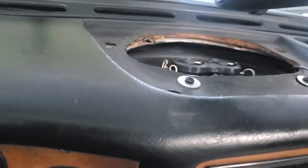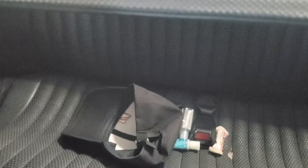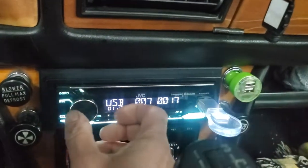This is just the speaker — it's a left and right channel. In the back, I actually have a powered subwoofer sitting behind the back seat where the soft top frame sits. That was about a hundred dollars and I didn't have to make any holes in the cubby holes. I'm an 80s guy and I like to listen to pop music, so there are songs with a bit of bass. This particular speaker can be configured as a subwoofer or a full-range speaker, so I have it as a speaker with left and right channel, and I just balance the controls from the head unit.